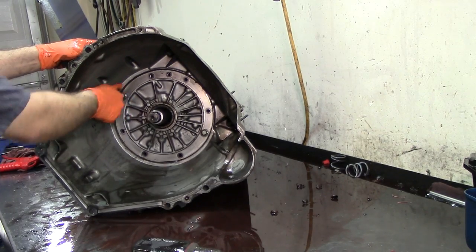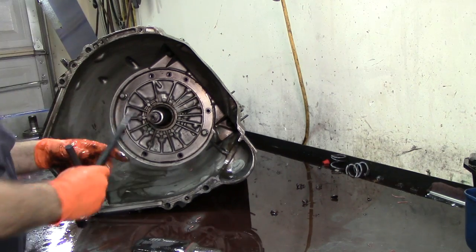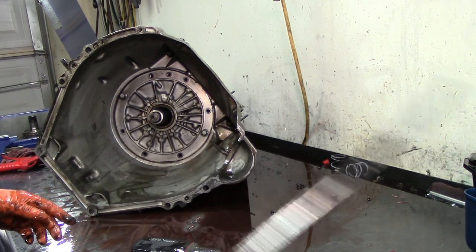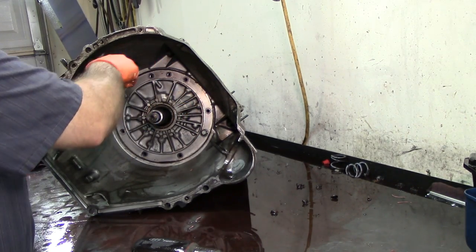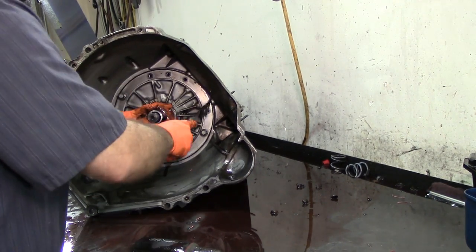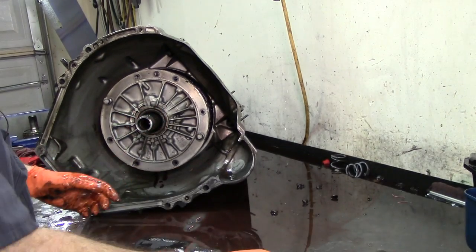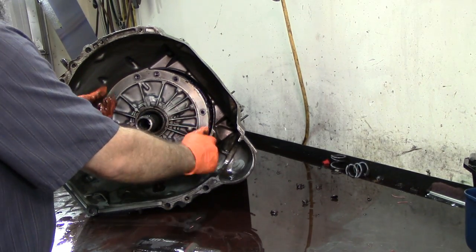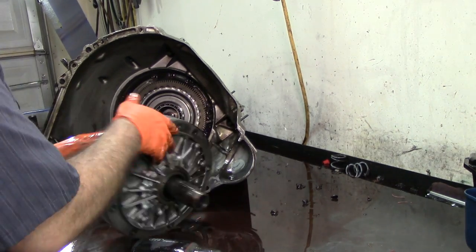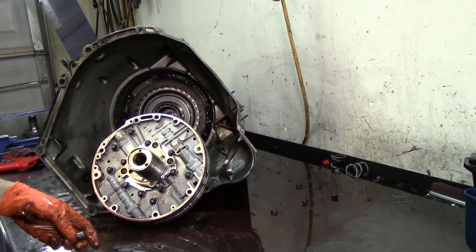Now I'm going to try using this — I usually take them off with the larger one but I misplaced my tools. Right now I'm using a seal puller, an old one, and I'm using two bolts from the extension housing. There are two positions that actually have threads on it, so you can use a slide hammer. I do have a slide hammer but I don't have the right size for this pump. So I always use the extension housing bolts. If you're thinking of buying a slide hammer just to get that thing out, just do what I just did.